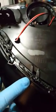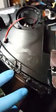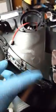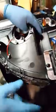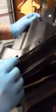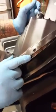Fairly small, but just make sure they all line up because you don't want it to stay open or have any cracks in it, allowing moisture or condensation to accumulate in your headlight. So just do the same thing all around. Same thing around right here. There's another one. You can see it's pretty much way off because it still needs to slide down some more and then in.